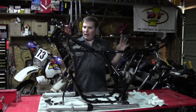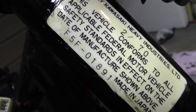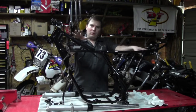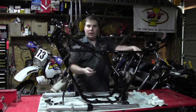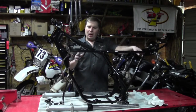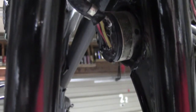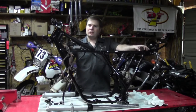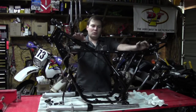Alright. It's been a while since we've seen the frame here. I did a little bit of painting on this — a word about how I painted it. I used an acrylic enamel, automotive grade, because that's what would have come from the factory. Now, some people would say why aren't you just powder coating the frame? I could have done that, but the thing is there are a lot of little accessory pieces that would be hard to match — sometimes powder coating black isn't black all the way around. When you've got small pieces that you might want to just spray paint out of convenience, or it just isn't practical to powder coat, you can get a good hard finish by doing proper prep and using the proper paints.